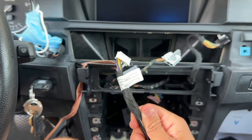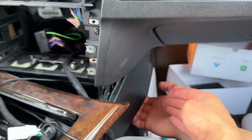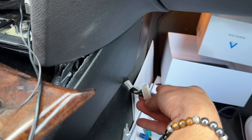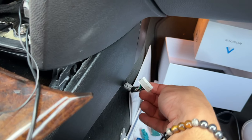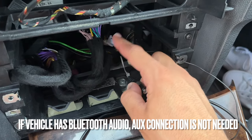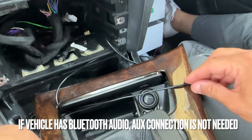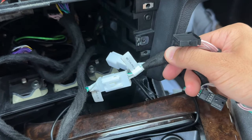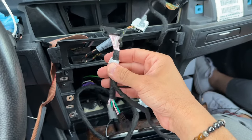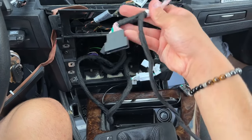Route the CAN power cable down through the bottom side here and it's going to come out of the footwell located right here. Go ahead and secure your aux cable — make sure it doesn't fall back into all the other cables. It's already connected to the harness, so route it underneath straight into the glove box. Make sure all of our connectors are plugged up, then grab this side of the wiring harness and plug this connector into our iDrive controller.